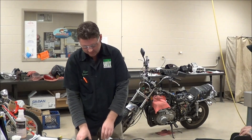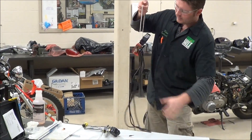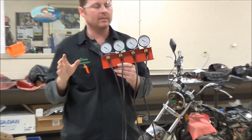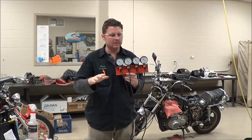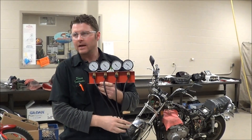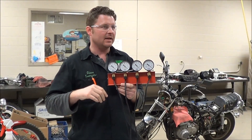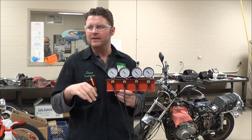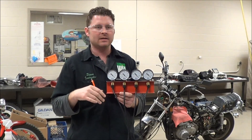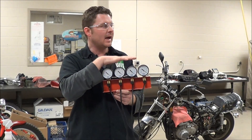So I'm going to talk about why a lot of people don't like these vacuum gauges. Does anybody know an old mechanic that says, carb gauges are junk, I just tune it by ear? It's kind of a common complaint where somebody will say, I've set the bike to those gauges — I'll have a bike that's just running perfect and smooth — and now all of a sudden I got them all equal and it's hunting or jumping or spitting and sputtering, and they say the gauges are junk. The gauges are not junk.